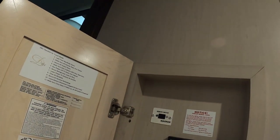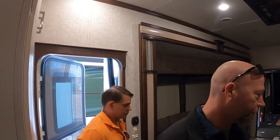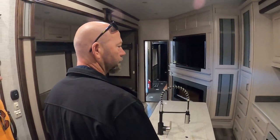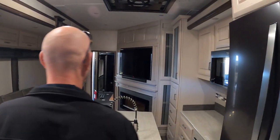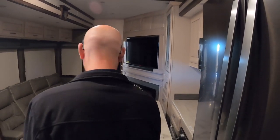So which one do I do? You've got bedroom vanity, door side. You've got door side and off door side. Do door side first? You can do off door side first — it doesn't really matter. See mine with the hydraulic in-command, it pulls that slide in first and then this slide. Usually it's just whichever one has the least amount of resistance and it'll come in first.